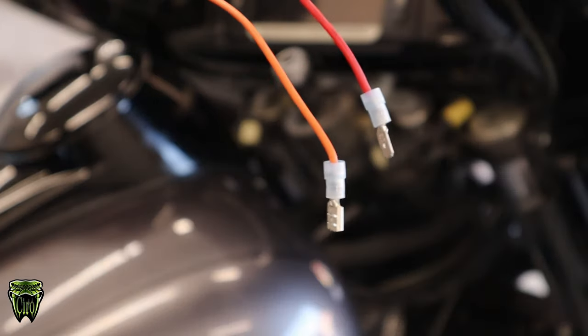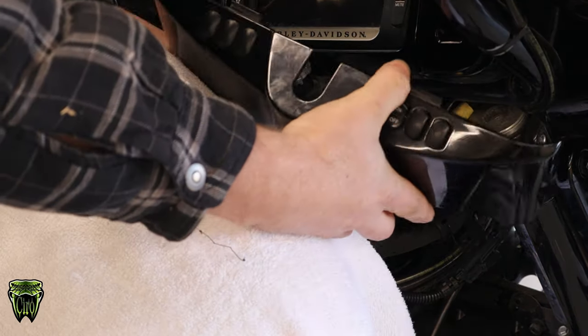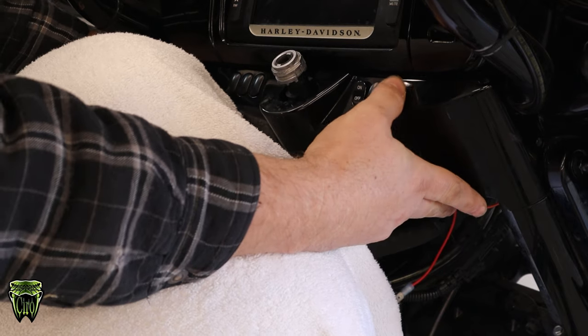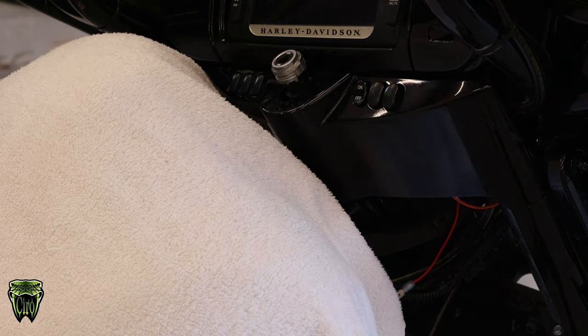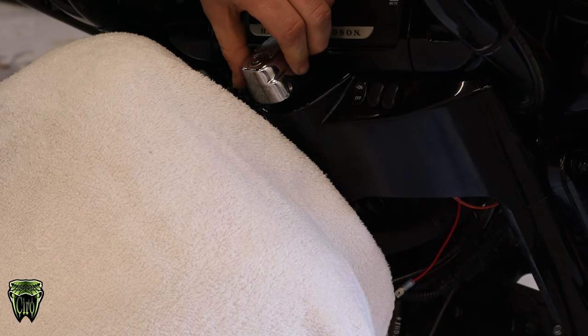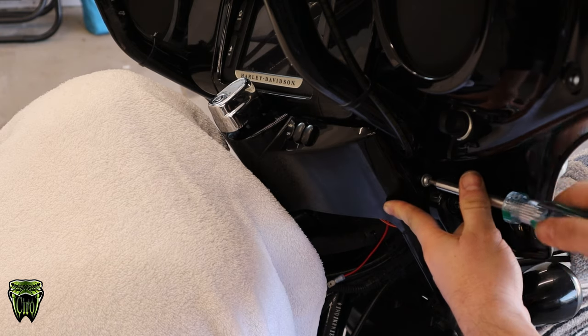We'll feed these wires back up through to the front of the fairing. Just when you feed these wires in, make sure they are accessible from the front of the bike and you can still get to them. Ignition goes in — don't lose your spring. Make sure the bike turns on and then we'll go ahead and tighten those up. It's only about a five to ten minute job to take that panel off. If you try to do it without taking the ignition out, you don't have enough room to get the screwdriver straight on, and you risk damaging the plastic threads in the bottom of that panel. So take the extra time, pull the ignition off — it's not that big of a deal — and save yourself a headache down the road.